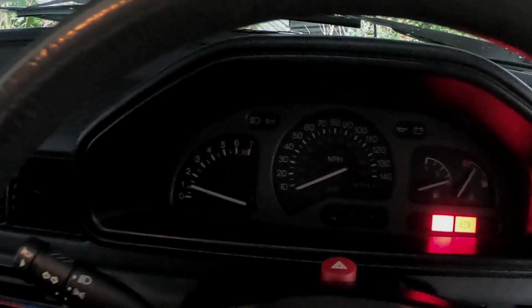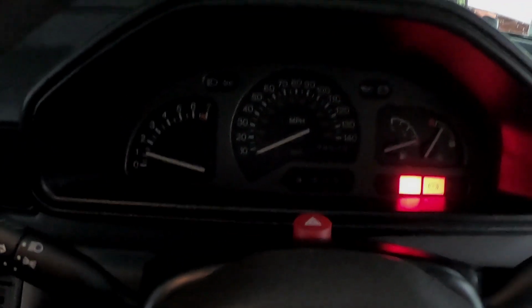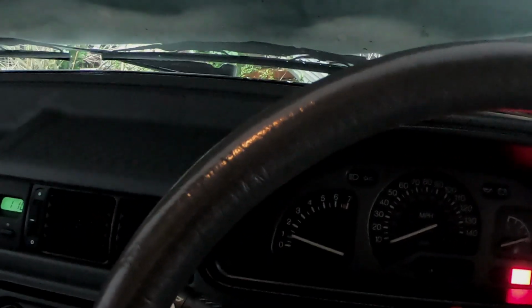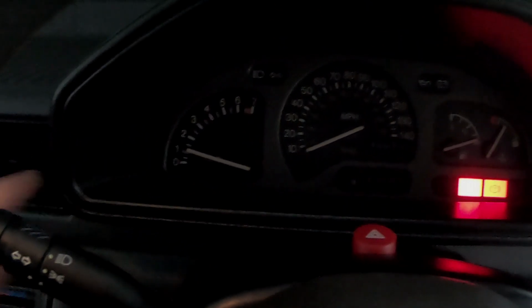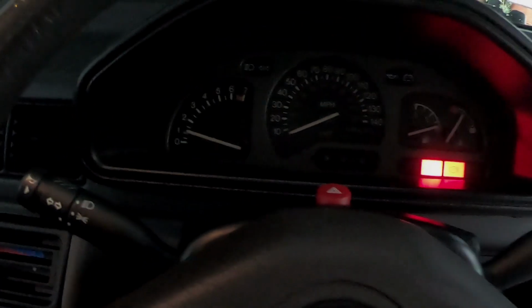These carburetors, these 2830 DFTMs, are not particularly renowned for their reliability, which is strange because I thought Webers were better, but they are when they work, and this one now is functioning and behaving a lot better, and the car is happier. I'm quite happy with an idle speed like that, even though I would preferably want it to be at 1,000. I'll see if I can get it to be 1,000 RPM at idle.